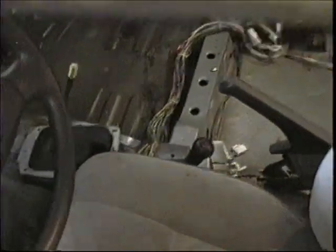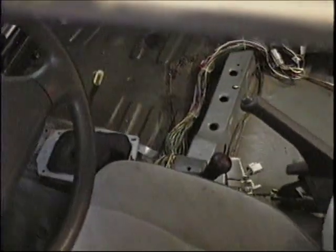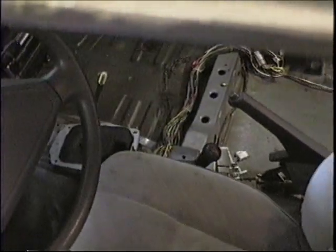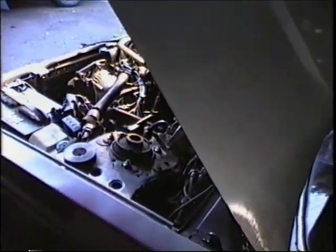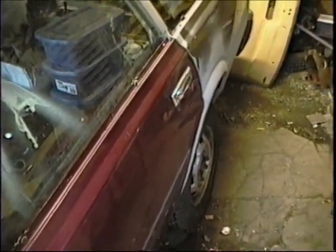This one has been converted from a 4-speed full-time automatic to a part-time 4-wheel drive dual-range transmission. What was involved with that, we had to pull the motor out and change the transmission. Along with the transmission, we had to change the axles because the axle spline count is different. Along with that, we got new pads and rotors on there as well. In the rear, we had to change out the 3.7 gear to a 3.9 gear and use the existing rear suspension with new disc brakes.